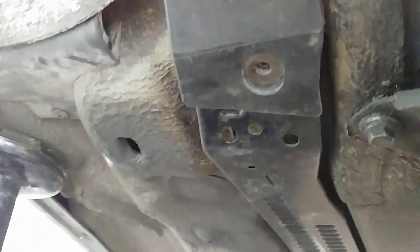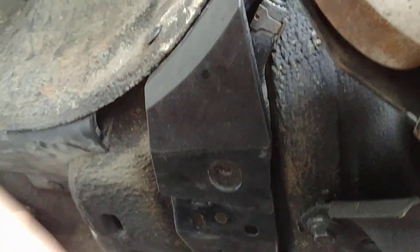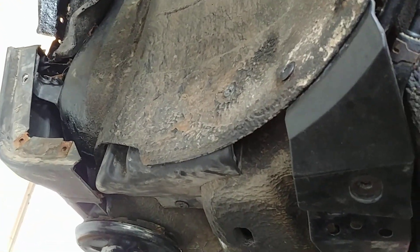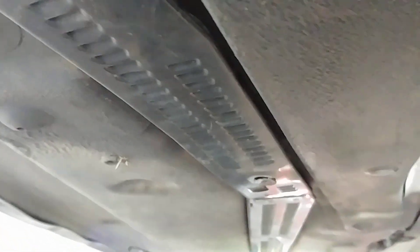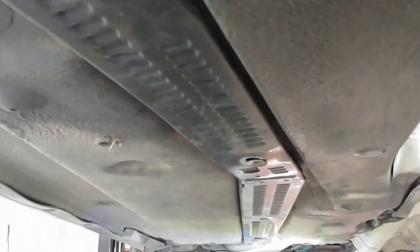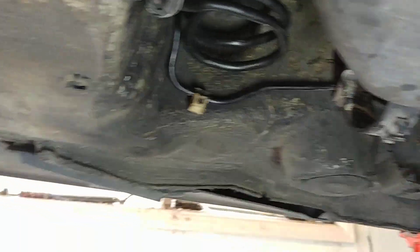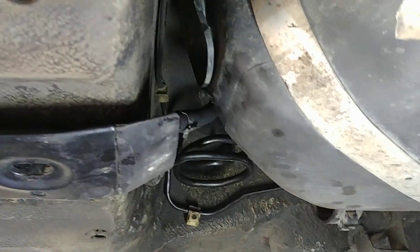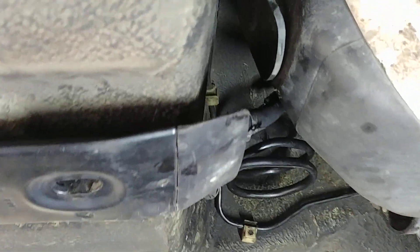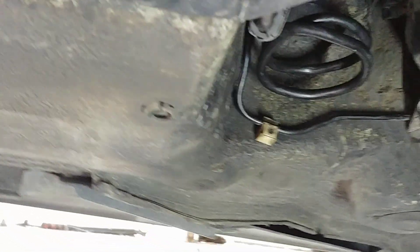The only thing I did is this front little plastic piece, about three inches, is original all-road — I cut it off and put it here because the inner fender liner left a little bit of the fuel lines exposed, and that's no good. The fuel line routing is identical until we get to the rear. On the front-wheel-drive Passat the fuel tank doesn't come up as far forward as this one — obviously they have more room back there without the diff. The return line runs to roughly the same spot; it's actually about an inch shorter than on the all-road fuel line, but the rubber line still reached fine.